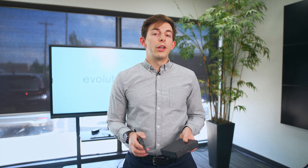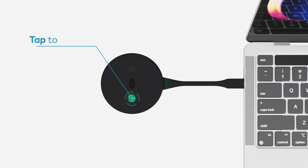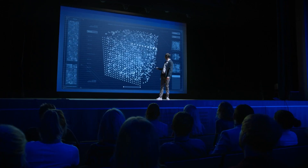First, the screen sharing utility installation. Most screen sharing dongles require a program to install before you're able to share your screen. This happens in the background and usually isn't noticeable unless your IT department has policies that don't allow untrusted programs to run. However, the new generation of AirMedia connect adapters can transmit video signals sent right out of the USB-C port. This means the wireless display shows up on your computer the same way a second monitor would, and you can extend or mirror your display without needing any software drivers to run.